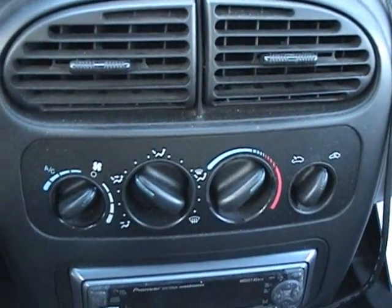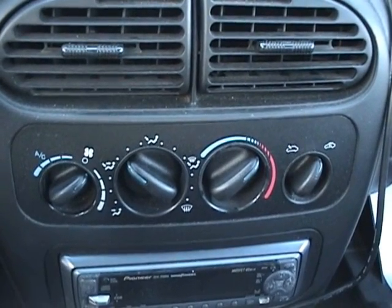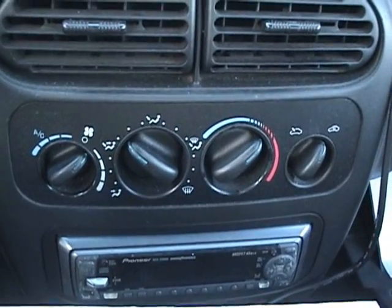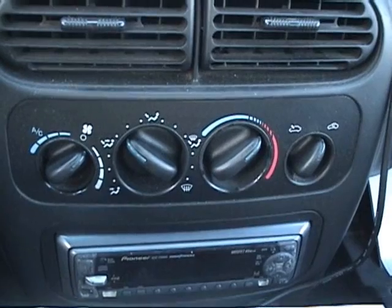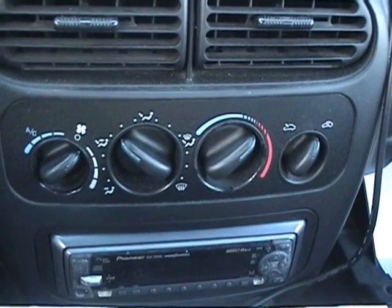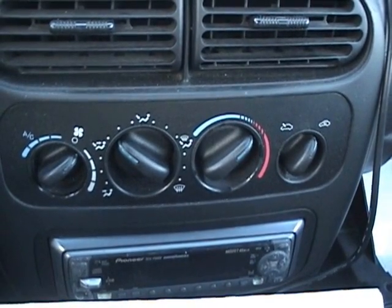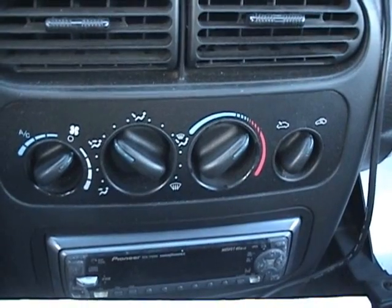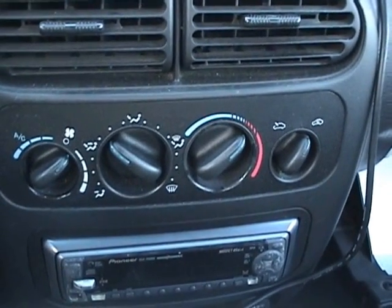We're back and filled up. We went 54.9 miles and put in 1.37 gallons, which gave us 40.07 miles per gallon — a little bit less than normal for these test runs. So unplugging the O2 sensor had very little effect. I filled back up and I'm going to run a full tank through — 300 to 400 miles — to get a more accurate reading. But initially, 40.07 miles per gallon on 1.37 gallons over 54.9 miles. This concludes the video. Thanks for watching.